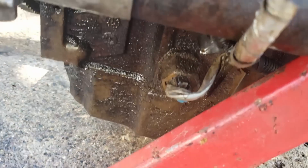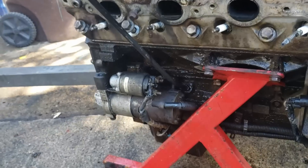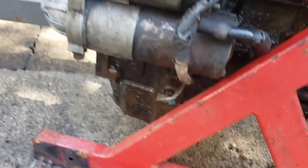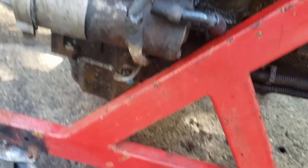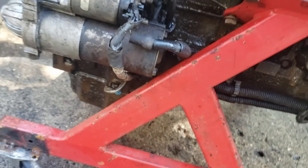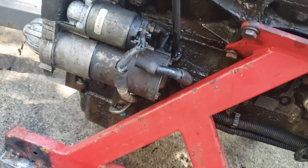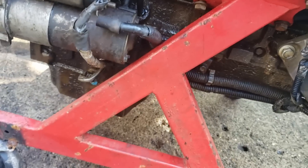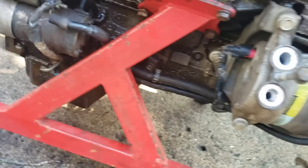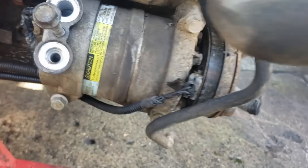Down below that's your oil level sensor. You don't have to have it — you can delete it. They may have a little plug that goes in there, or you can find a large bolt — I think it's like a 15mm thread, maybe 18, I'm not sure. I usually plug them because that sensor's plastic and I don't want it knocked off while I'm swapping things around.